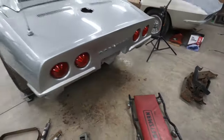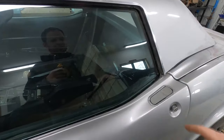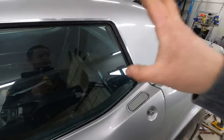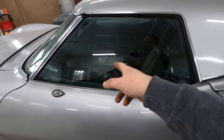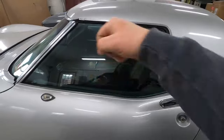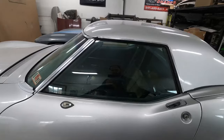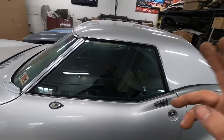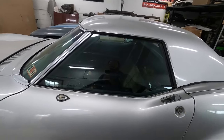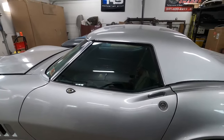Now I've got to clean up my mess and then take off the hard top, clean the inside of the car, get the storage bins out, and get the rest of the carpet out. To put the hard top back on we have to remove a battery cable. Then we need to take apart the console to get to the shifter because it's like a T or a bent handle, so it'll be a little tricky to get the body off with it in place. We also need to remove the emergency brake cable. After that, I think we're pretty much ready to loosen all the body mount bolts and pull the body off.